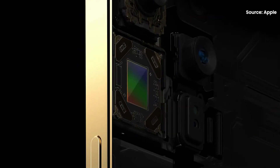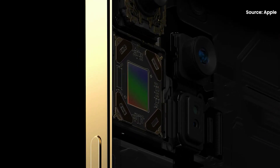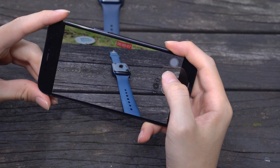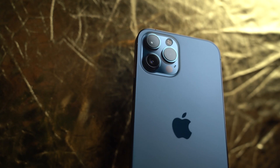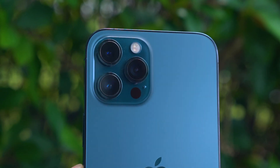Most smartphones come with optical image stabilisation, where the lens is responsible for reducing handshake blur when shooting photos or videos. However, the iPhone 12 Pro Max comes with sensor shift OIS, which is more similar to in-body image stabilisation commonly found on mirrorless cameras. Rather than letting the lens do all the work, this system incorporates a floating sensor to counterbalance hand movements. Apple says that this new tech can stabilise an image at over 5,000 times per second. Note that sensor shift OIS is only available for the wide lens, which is the main camera, so you won't be getting this on the ultra-wide and the telephoto camera.